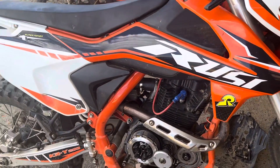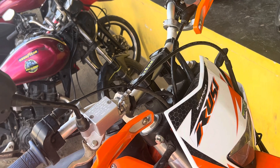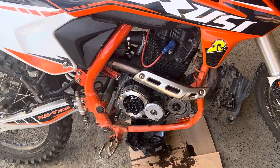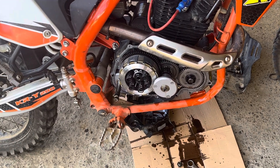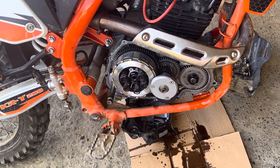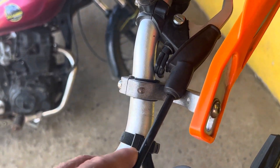I was having a hard time with the clutch — it was overheating and I couldn't get it to disengage. Once you stop the motor and it cools off for a half hour or so, then it starts working fine. So hopefully this will help fix it. We're putting in the Honda TMX plates and the Sniper 155 springs. Eventually we'll also go to the Honda XR200 clutch cable so we can replace the clutch cable.